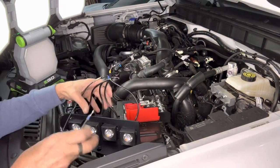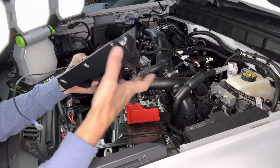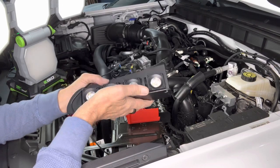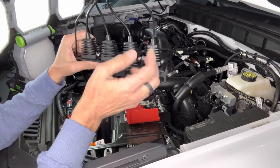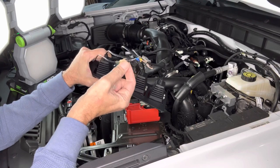Anyway, just something to do in case you somehow had a faulty light or any other problem before you go and get this all mounted in and wired into your vehicle. The first time you test it is by powering up your switch on your aux. I like to just go ahead and make sure the electronics are working so I know everything is wired up right and all of my negative wires are properly connected in together.